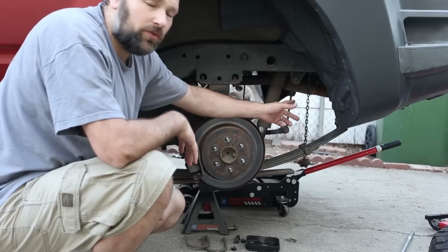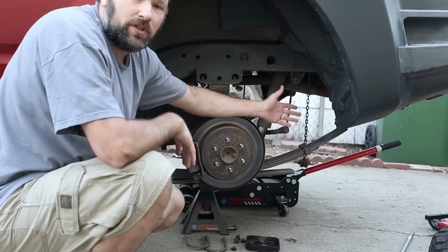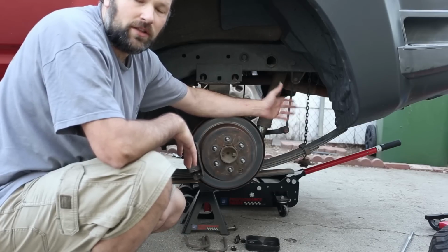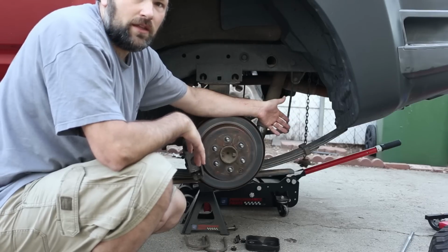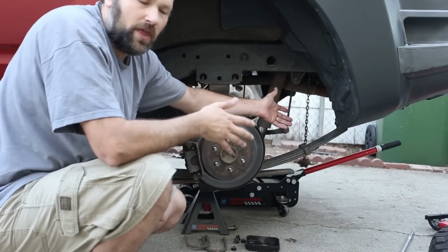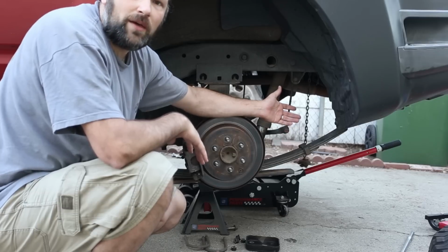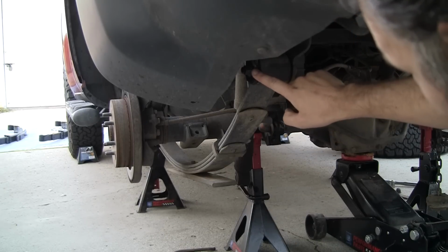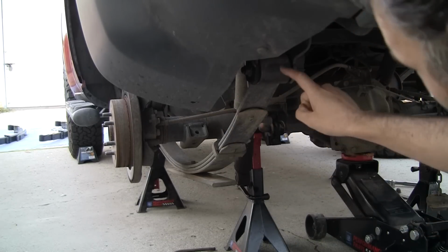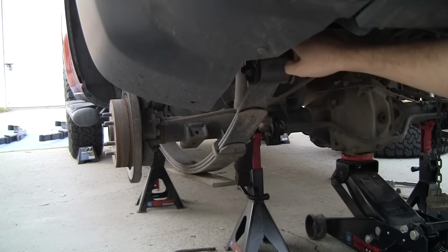So actually there are two bolts. One is what holds the leaf spring to the shackle, and then the other bolt is connecting the frame to the shackle, and so those two actually move around. So I actually need to hold one bolt and then the other at the same time and sort of apply opposing force. So I'm going to show that, but it gave me a little bit of trouble at first, and it's also tight quarters, so that makes it even more exciting. So here we go. Okay, so you can see right here, this bolt right here is holding the leaf spring to the bottom part of the shackle, and then up higher, which you can't see, is another bolt that holds the frame to the shackle.